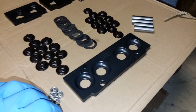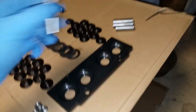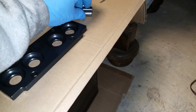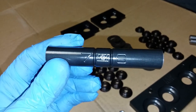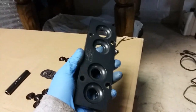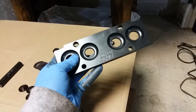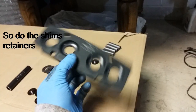Moving on to the valve spring compressor — in a moment I'll show you how this actually works. It utilizes the studs for the camshaft trays, and they supply these little spacer rods so you can begin to compress the valve springs. They also supply a really nice valve stem seal driver that accommodates two sizes: seven and six millimeter — more commonly we'll be using the six millimeter. One last thing: this valve spring compressor is a versatile tool — it not only works for E36 engines, it also works with E46 engines, meaning it can compress the valve springs of the M52 TUB series and the M54 series. Alright, let's get to it.